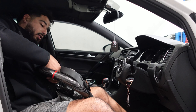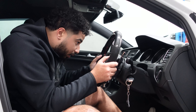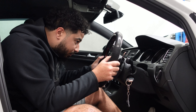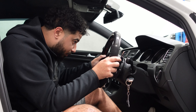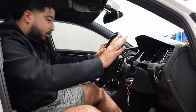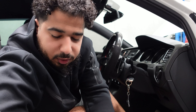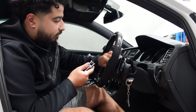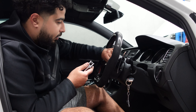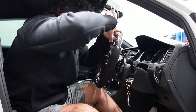Once it's tight, have a look around and make sure everything is sitting flush and all the clicks and noises are there. In reverse order, grab the wheel, line it up to the hole, and adjust it to find the best sitting position — being OCD about this part is good. Once it sits flush, apply some thread lock, then put the central nut back in. We tighten it to the German torque spec — good and tight — and make sure there's no movement.